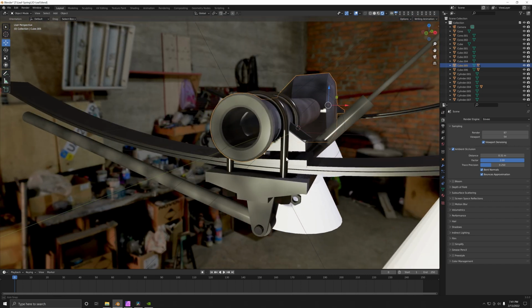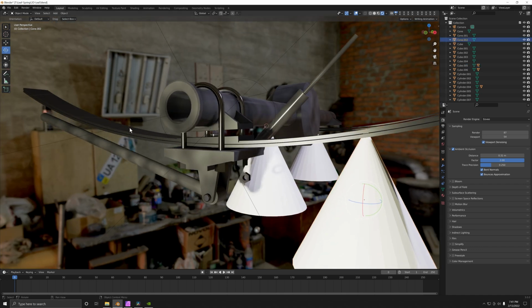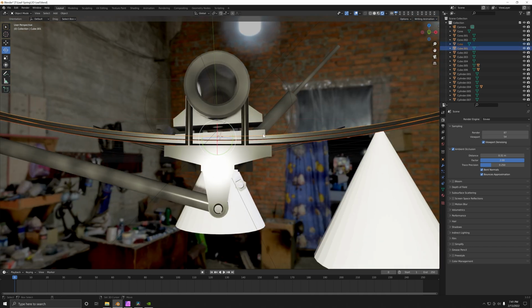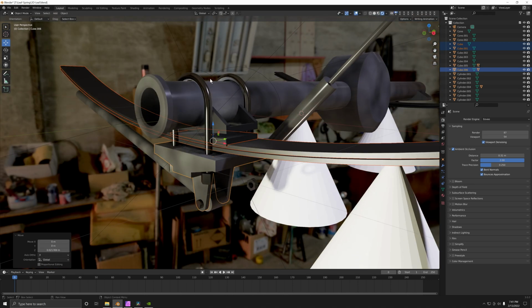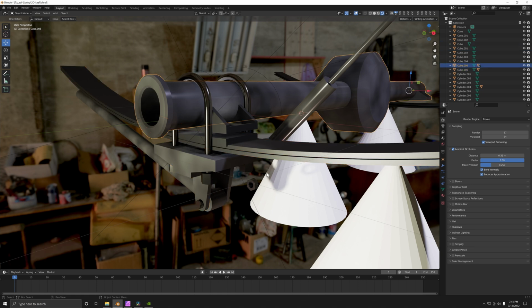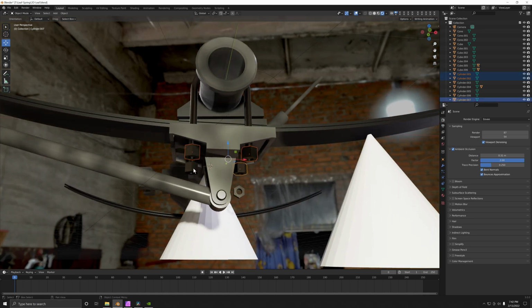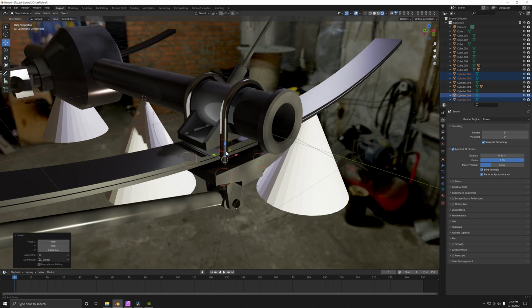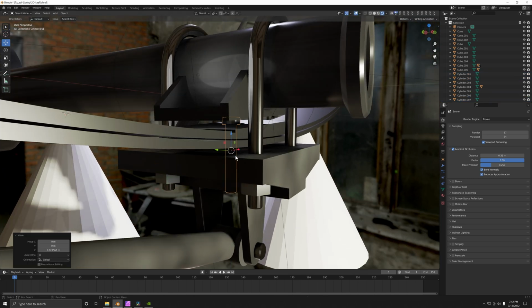Now, this part is a little easier said than done. Keep this loose and jack it up, right? You want to take your jack and jack up your leaves. Maybe I should have parented this stuff, but anyways, this nerdy graphic stuff that I'm doing. So you're going to jack it up a little more, and you want to keep these guys loose right here on your differential, because if you tighten these up too much as you're coming up, and too quickly, it'll throw the alignment of your pin off. Oops, I moved the alignment right here. So this pin has to stay there.